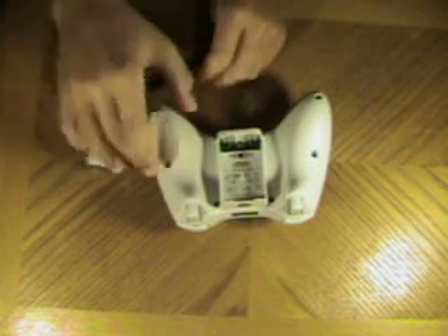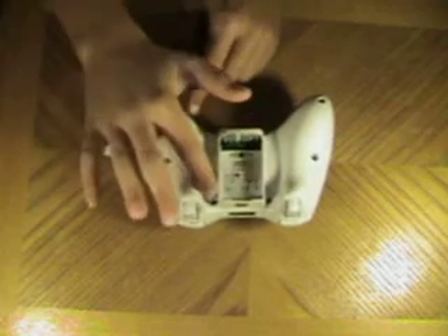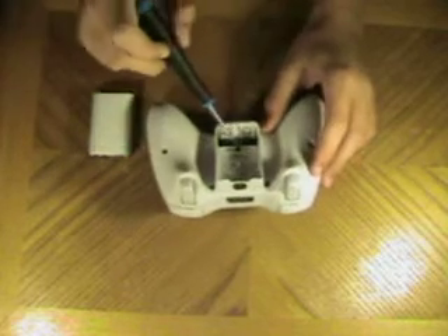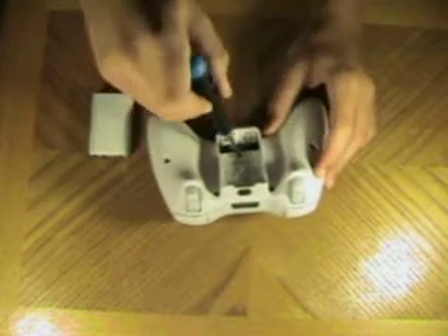The reason it needs a security hole is if you look at your screws, they have a metal spike coming up and you'll need to use this to get in there. But if you just have a regular Torx head and don't feel like going to buy one with a security hole, you can break the spike out in the middle using a regular screwdriver like a Phillips head, and then just unscrew with that.